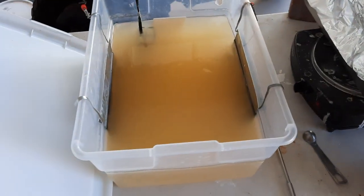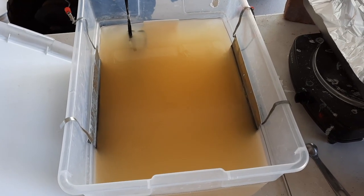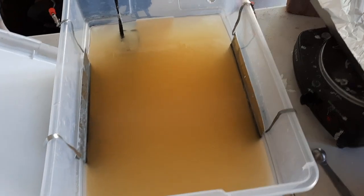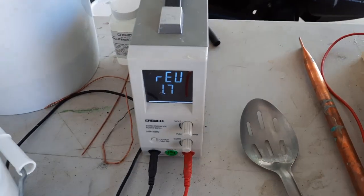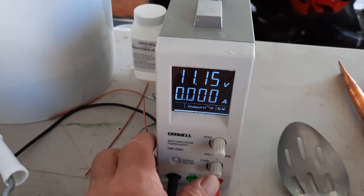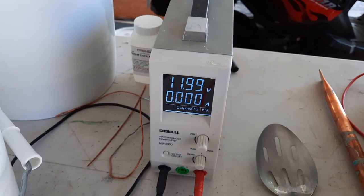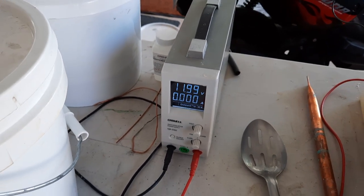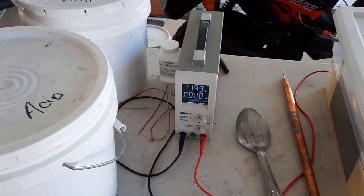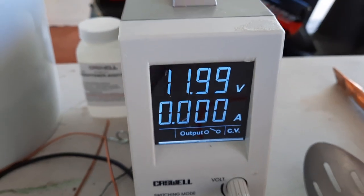And I also am now really trying to measure surface area and adjust amperage. So what you do is, there's an actual surface area calculator, and for the last ones I plated, the current was 3.899. Basically it was 4.0 is what I calculated once I did all the measurements of the parts, and then you multiply that by 0.14 to get your amps, and that's the lower section there.